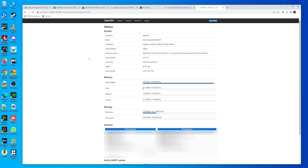Okay, so there's a couple of things that we want to do to improve your gaming. One of them, and probably the most important, is a thing called buffer bloat. Buffer bloat is an induced latency in your network traffic from your machine to a game server. Let's say you're playing Call of Duty and you suffer buffer bloat. Essentially, the packets of information leaving your computer can pile up in a buffer. What that actually means for you in the real world is when you click to fire, there can be some induced latency happening because those packets are built up. In other words, you ultimately lose a firefight, because milliseconds count in gaming.